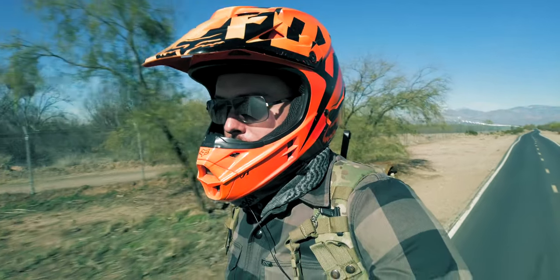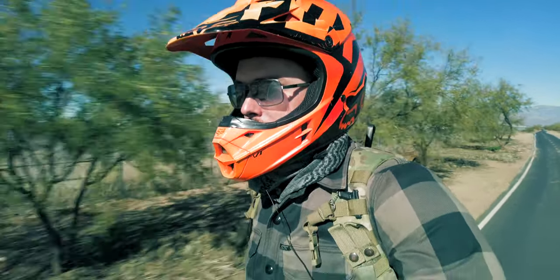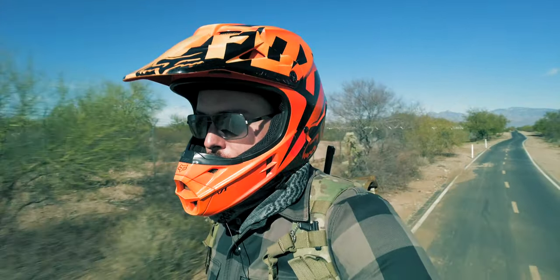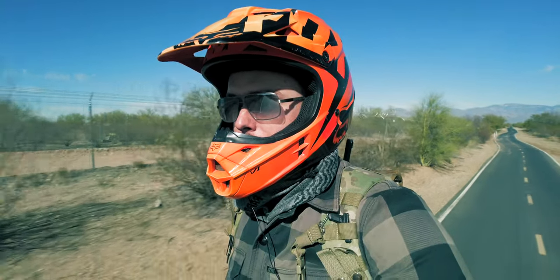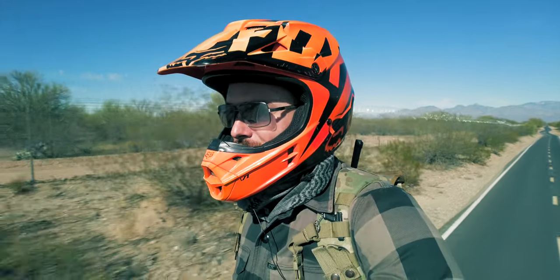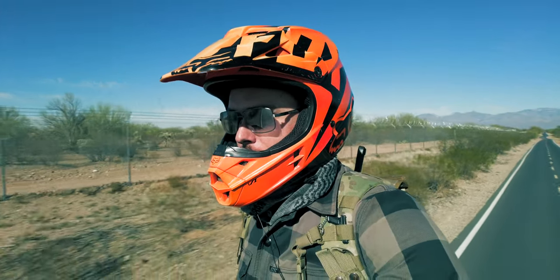While I was doing a lighting job — which I'll show you later — I wired the flashing front light, which is useless anyway, to my auxiliary lights so I could turn them on and off with the flashing light switch. Apparently that was too much wattage and it killed that side of the circuit. So the headlight works, just not the flashing lights. But my auxiliary lights are just fine.